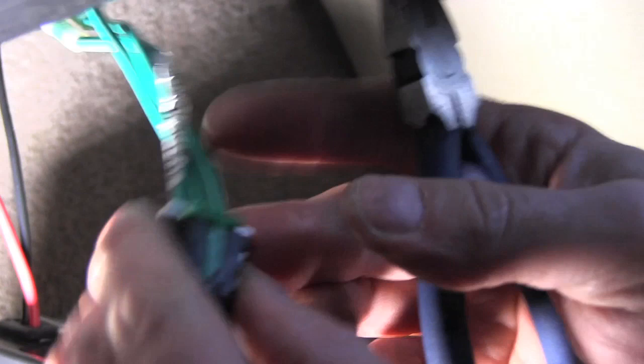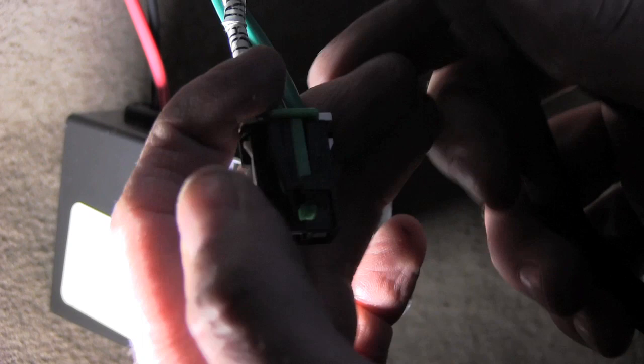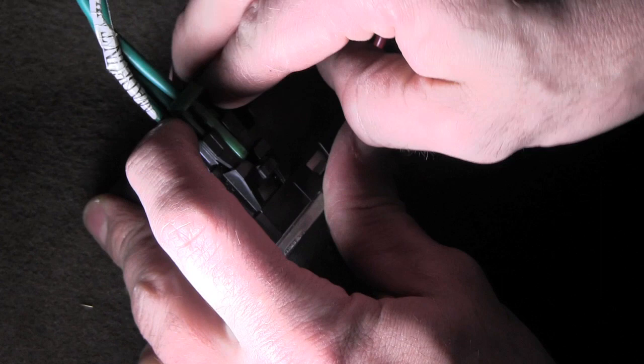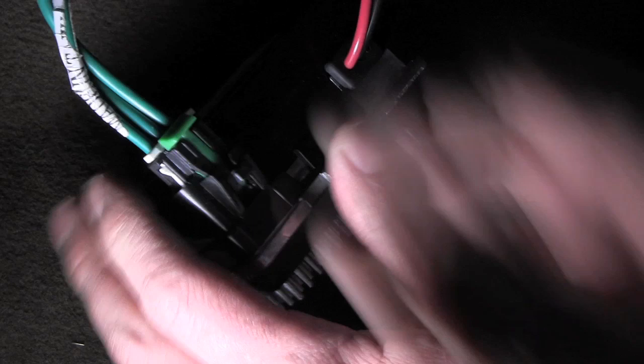We'll move the camera back a little bit so I can get under here and work with two hands. That one's all wired up. Now we're going to wire our box up underneath there — pretty self-explanatory: red to red, black to black. I noticed on this clip right here there's a little green locking tab — you see that? It won't let you push down to release or install it, so just push that up a little bit, then we can install it into our plug. Clip that in, push that in — that'll keep it from backing out, you can't pull it out. Now we're set.